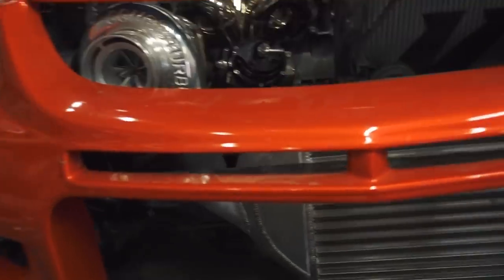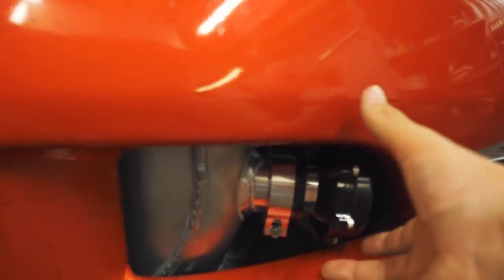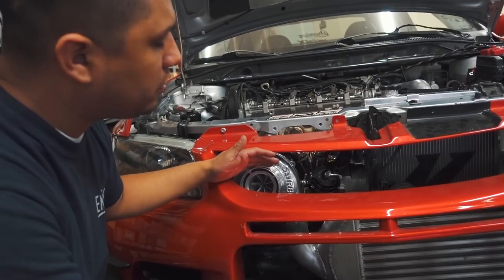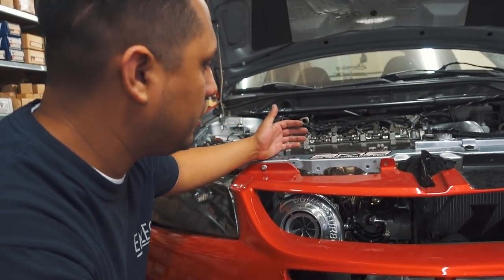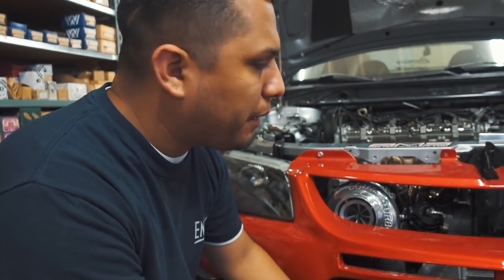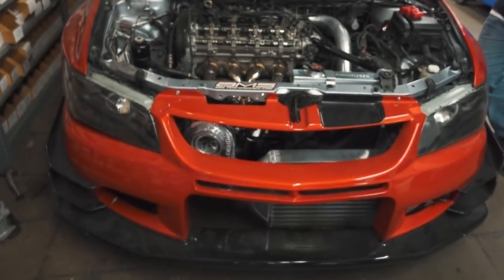With the bumper on — my favorite part about this car is the off-center intercooler. It's very unique. Entice was able to mount the turbo here and directly connect it to the intercooler with basically no piping, which gives it that off-center look, and the blow-off valve sits right here so you'll be able to hear all the great turbo noises. When you look at it from the front you can still see the wastegate and the manifold directly through the grille. The reason for the off-center intercooler and front-mounted turbo is that it runs a lot cooler — it's getting completely fresh air, not soaking up heat from inside, and it's a direct shot into the intercooler. So there's less travel for the pressure — less piping means faster response, pressurizing a lot faster.